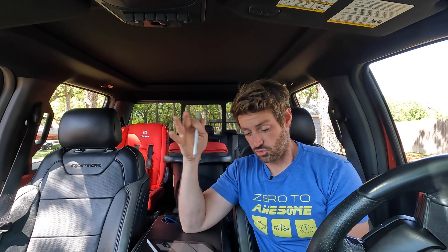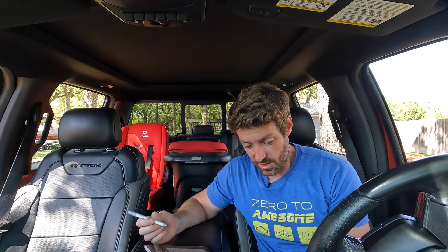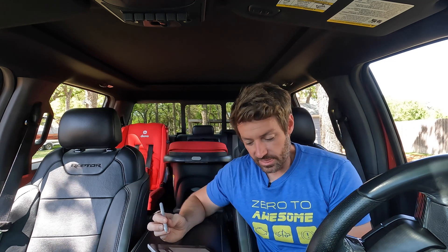I'm just browsing through stuff here. I went into the body control module and there's some interesting stuff. Ambient lighting entry color — so the LEDs all around the car are blue whenever you first come into the car, and the only thing you can change is the color when the car is running. I've never liked that they're blue when you come in because the truck is red. We're going to see if we can change this lighting color to have the LEDs always be red instead of blue. There are also some other interesting things in here like daytime lighting, fog lights if high beam is on — apparently you can change it so they stay on when you turn the high beams on.